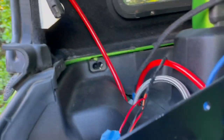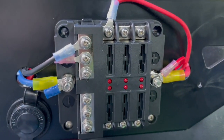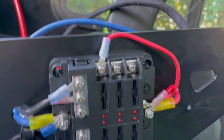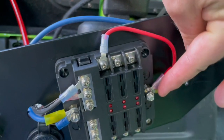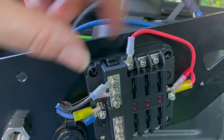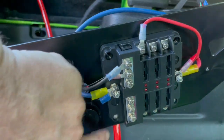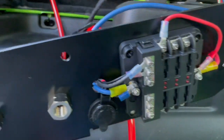And the big blue and red wires are the positive and negatives going on the ends. And I've got the grounds on that side and the hot over there on the other. The battery tender's coming right off the same one that came from the battery because we want to make sure that the voltages are as accurate as possible. And this here is what will be the fridge, because the fridge is going to be running off of this. So that'll be there. And yeah, just got to shove these air tubes in here.